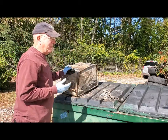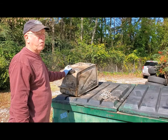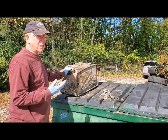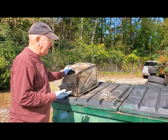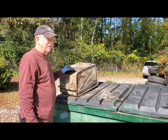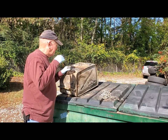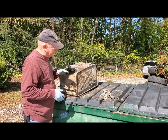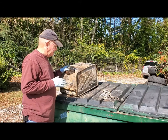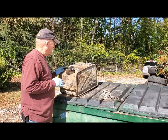I'm not man enough to toss this gas tank around enough to make it bang around the inside with water in it. The other reason is that this stuff was really tenacious. It was secured to the bottom of the tank, really tough scale. I'm gonna have to apologize to my dental hygienist next time I see her, because that's the kind of thing she has to go through with me. But I was able to get a long screwdriver and manually chip the stuff out of the bottom and get to good clean metal. I hope I haven't damaged anything under there. I wasn't beating on it that hard. But I think it's ready to go back in the truck.